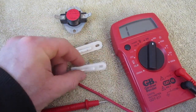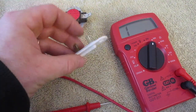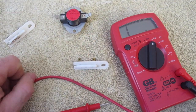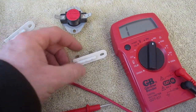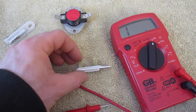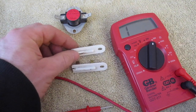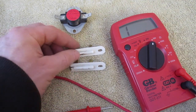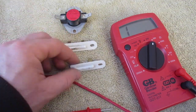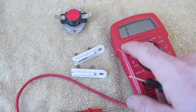A lot of people find that they have a bad fuse, but they don't fix the issue that caused the bad fuse. They just put another fuse in, and the fuse goes out in a month, and they're like, that's a horrible fuse, there's something wrong with this fuse. You really do have to make sure that you go through and check your dryer lint. Make sure that everything is blowing out okay — that's probably the number one cause for these going out. Hopefully this helps. Good luck to you.